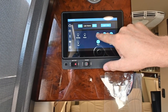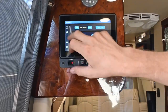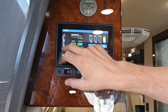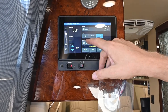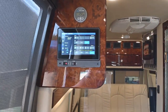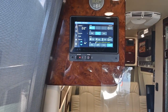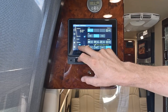Anytime you see an arrow on these buttons, you can hold it and dim the light — so that's the front lights, it's a dimmer. Hold it down and it goes back bright, so we have dimmable lights. This is showing the inside temperature — I'm at 88 degrees. If I want to turn on the rooftop air conditioning inside, I can go to the climate control section. With the engine running, I can run the Pro Air, which has cool and heat, and AC will come out of these vents. I'm going to turn it on low and set the temperature down to 72.